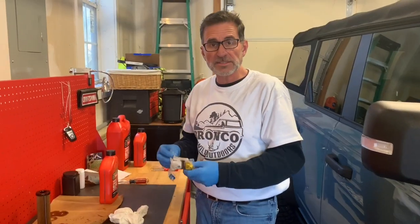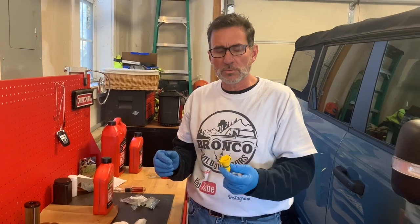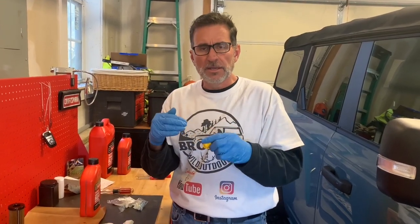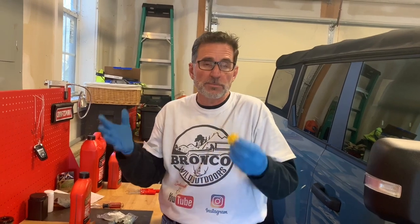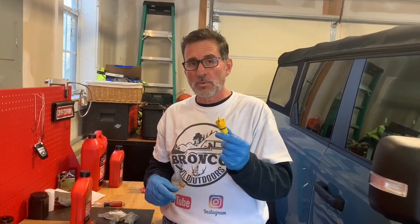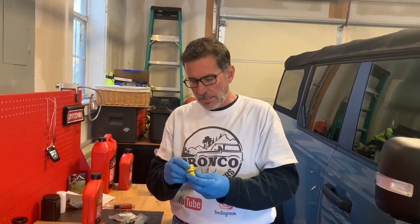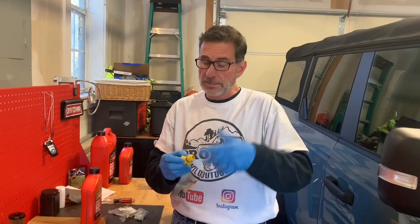Okay, now Becky, here's what we're gonna do. You're gonna get your 12 bucks' worth right here. We are gonna put in our new oil plug. There again, this is one of those little things. No, you don't have to replace the oil plug every time you do an oil change. It's just what I'm gonna do. I worry about this little O-ring on there and how well it seals long-term. I don't want any of that nuisance oil leaking out around it, where you get the staining on the pan and stuff. So I'm gonna try to prevent that, and if 12 bucks an oil change prevents it, well, there you go. You can also get these at AutoZone, at least in my area, for about $6. So if you choose to change it, fine. If not, keep using the old one, and when it starts to drip or whatever, I guess you can change it then.